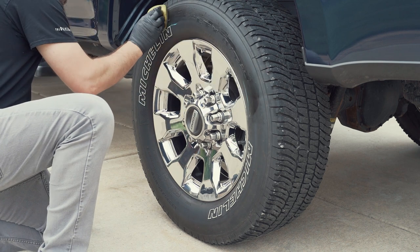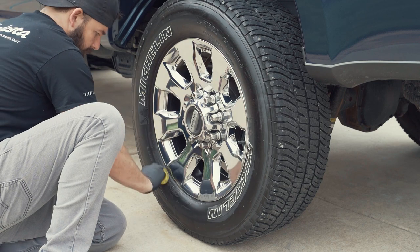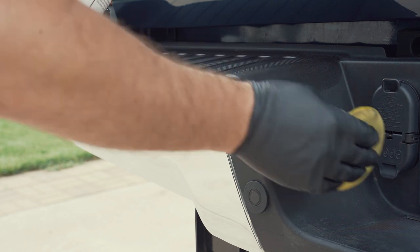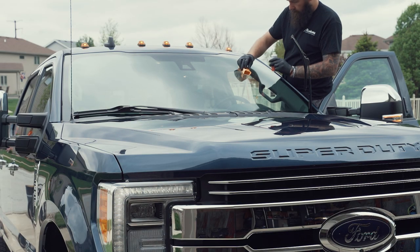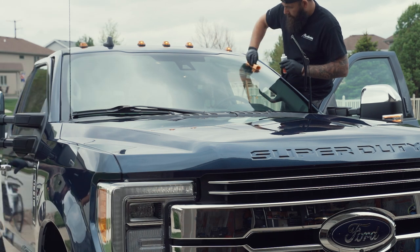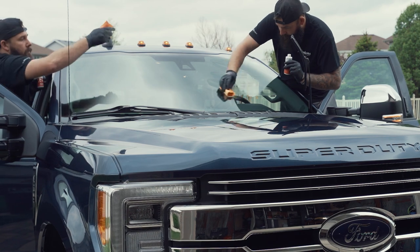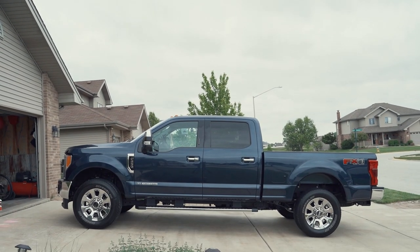This spray coating is one of the most difficult spray coatings that I've worked with. If you're not working in small sections or really making sure you're fully wiping off all that product, you're gonna end up with streaky spots on the car's paint. The fact that this was a little more finicky to work with probably means that it has a higher concentration of the SiO2, which is great for durability, but it does kind of suck to work with.